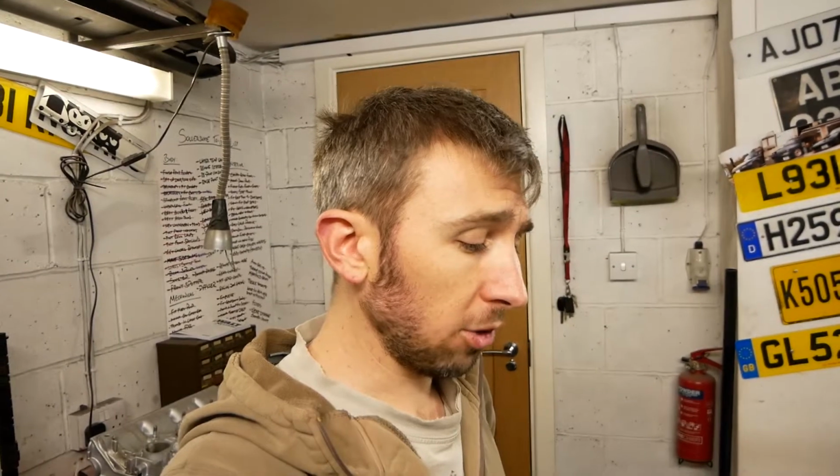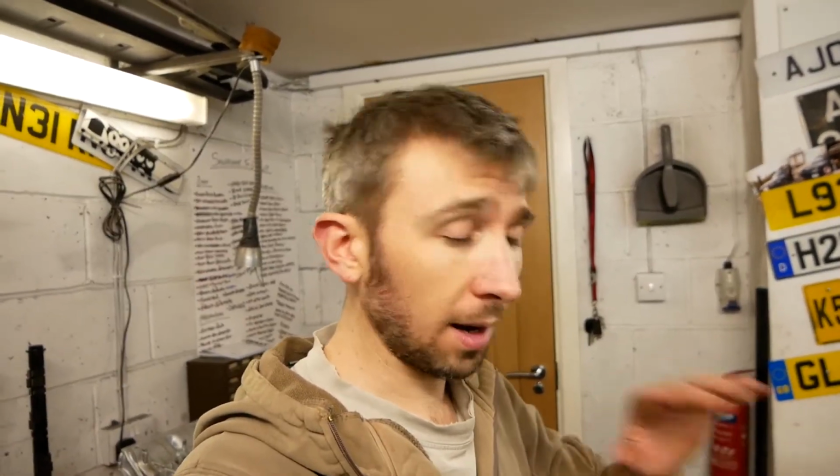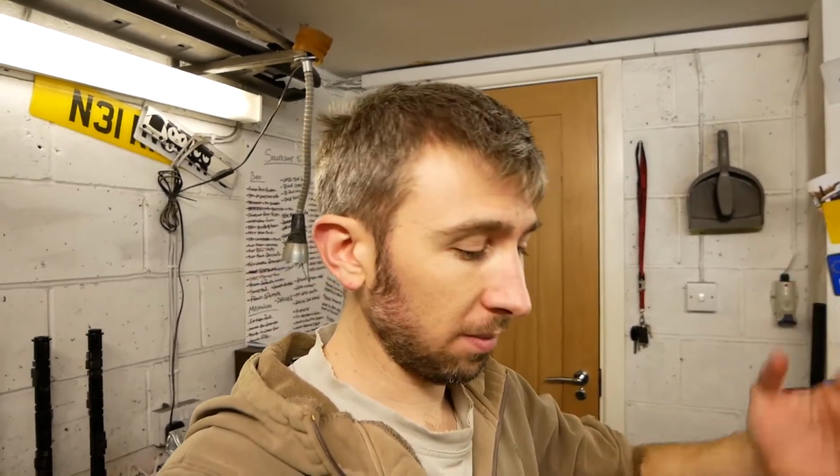And this is extremely annoying and somewhat worrying as well, because really it is one of the absolute basics in building an engine like this. The builder has to get the piston to valve clearances right, and clearly in this case he is far from right. So if that's been overlooked, what else in the engine has been overlooked?